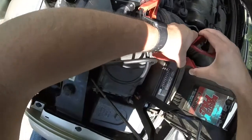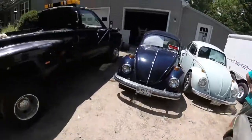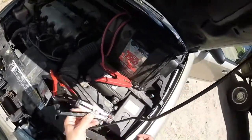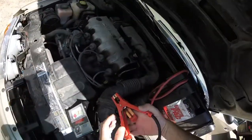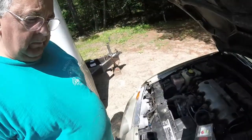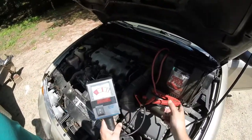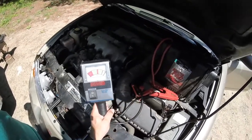Disconnect this here. You got the key on inside, maybe? Alright. So hopefully this will tell us the charging system is good. Yeah, she's charging — she's over 15 volts. Charging right up, so charging is good. So the battery is bad. Hopefully you can see there — with the engine running, we're getting almost 15 volts charging. So we know the alternator is working perfectly fine.